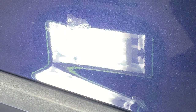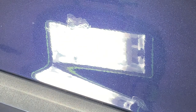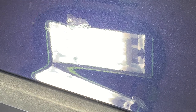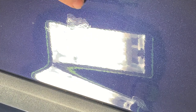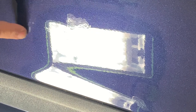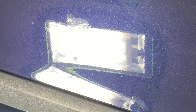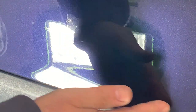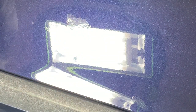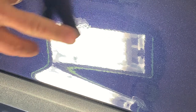I have some nice color match paint for this car and I've done some touch-up. I'm shining on a spot here. I've got a light and I'm trying to do the best job I can of illustrating this. You can see it in the reflection of the light through the camera. And if I run my finger over this, I can feel the clear coat on there. Now this is hard to see without good light on it. There's another spot over here — it's a high spot. So I thought what I'd do is show you some techniques I've been using to actually fix this.